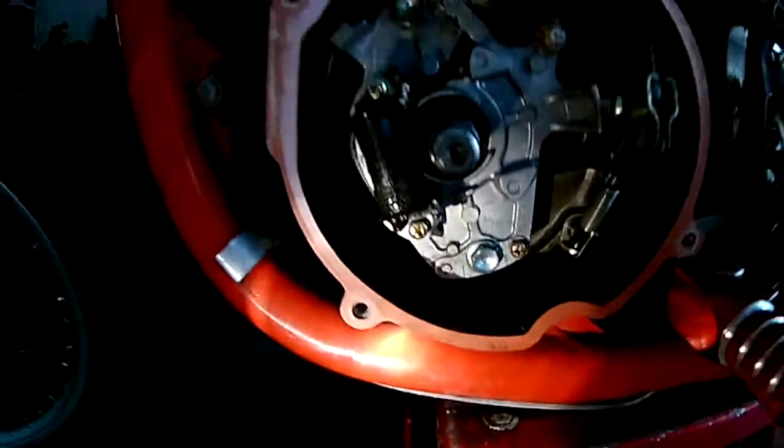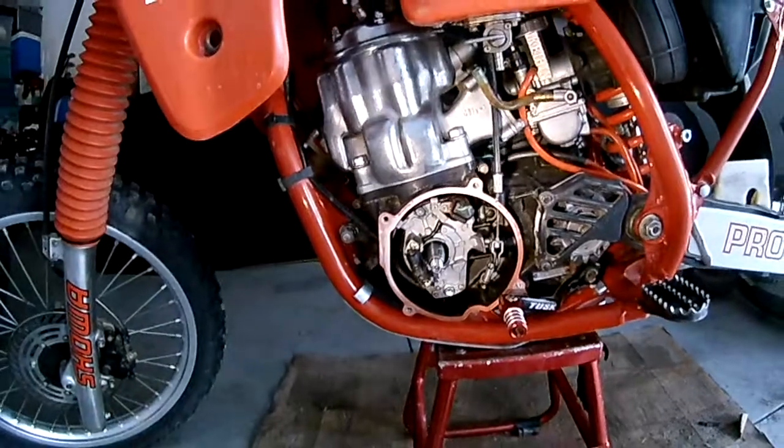It may help with altitude challenges — I'm at 5,000 feet but have never found that to be required. I run straight Honda factory settings. You don't want it retarded, and you don't want to over-advance it because then you could get into pre-ignition and detonation if you're not running really high-octane race fuels.